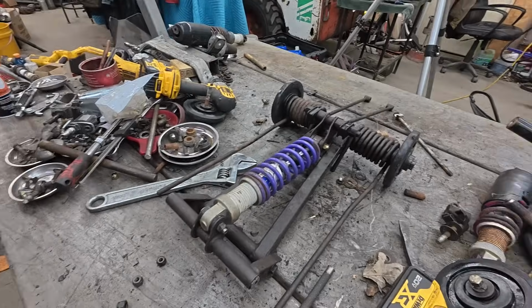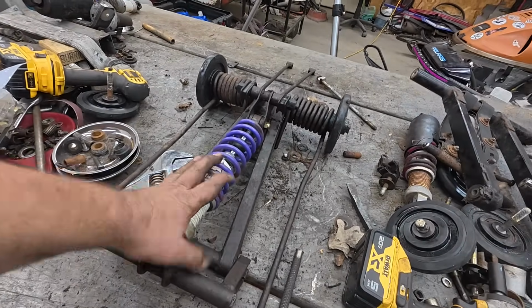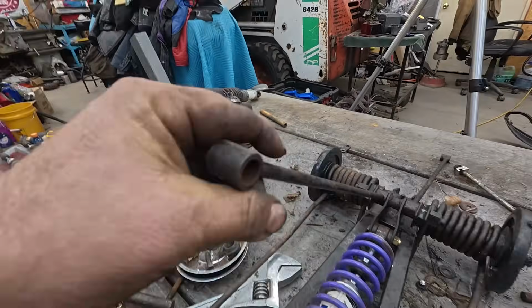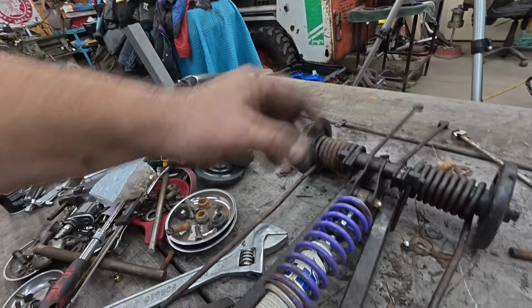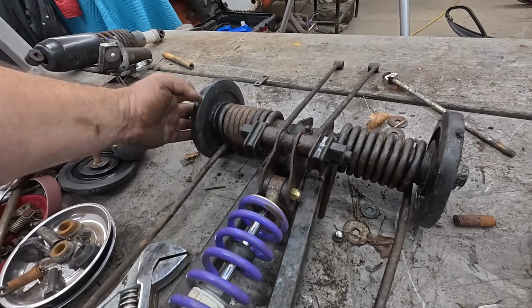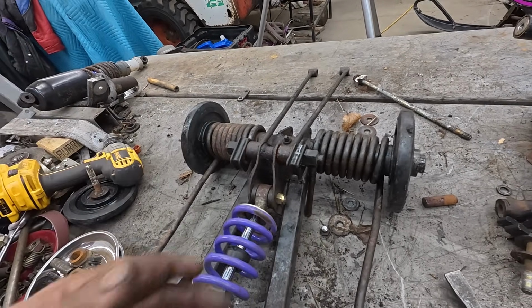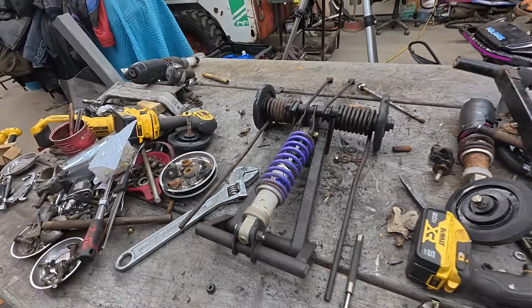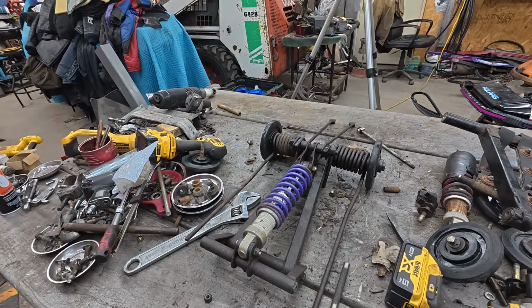Been working at it for a while. I have the back arm together. Got the shock on. Got the little bushings freed up and out of those. Shock bushings are freed. Hardware's good. This is the shaft that's free to slide. Got a pair of springs that match on it. Next step, I think, is to throw that in the skid. It's a struggle, folks. It's never easy working on skids.